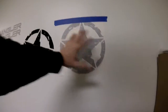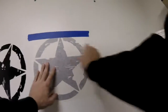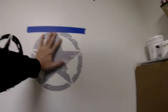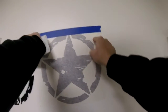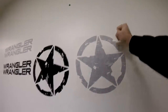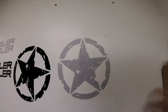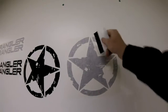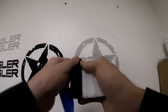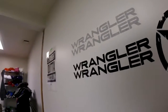If you're using the wet method, leave it on there. Once all the water is out — you'll know because it'll creep out the sides — you can use a hair dryer to heat it up and dry it a bit more. Then spray down the mask really well, get it really wet, and rub it in with your hands. The tack on the inside of the mask will literally just loosen so you can glide it off. There may still be some water trapped under the decal, but that helps work out any remaining bubbles. Wrap a credit card in a microfiber towel to avoid scratching the decal.